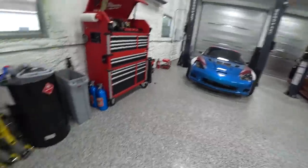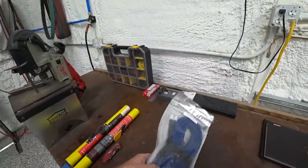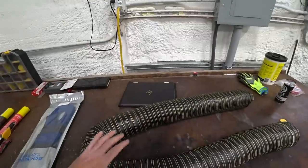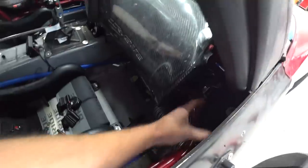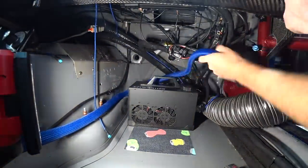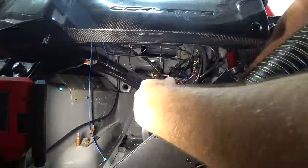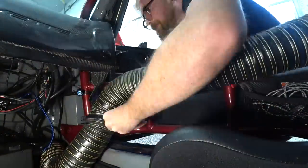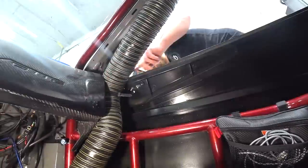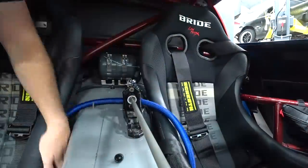We took a little vacation to do some driving, and we're back with parts in to continue. We got our 10-foot length of hose for the chill-out shirt, our headlight tint, and a 6-foot cut of 4-inch ducting. I wanted to get the ducting done first to make sure my plan was going to work. The easiest approach was to pull the whole chill-out assembly out, swap the new hose on, put it back in, and hook it all back up. Then we started zip-tying the ducting — it's not the prettiest, but it's functional and will draw in air away from where the hot air exits.